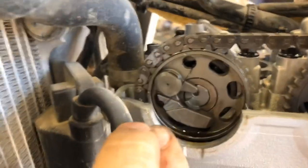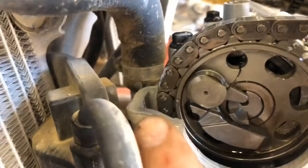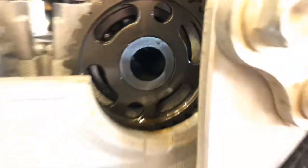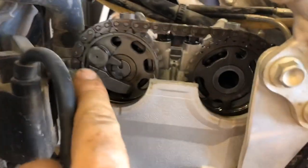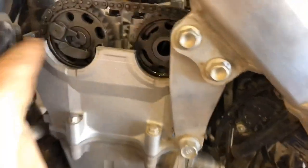What you're looking for is that little alignment dot right there, and there's one on the back on the intake cam — you can see it right there. Those should be parallel to the surface, so we're almost exactly where we need to be. Looking in here you can kind of see the line. As long as these are lined up parallel to the surface, we are good. You can be off just a tiny bit — you want to try to be as spot on as you can, but if you're off a little bit it is not going to hurt things.